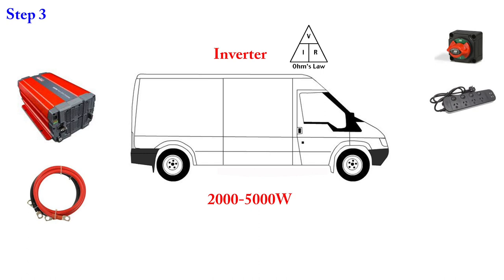You also need good cable for the inverter — something about the size of jumper lead cable, if not slightly larger. You can get this from boating shops. Then I recommend a very heavy chunky switch — something like a 200 to 250-amp mechanical switch — so that if anything goes wrong you can isolate it and also turn off the inverter when not using it. Some inverters come with remote keypads or eco modes, but I like to just use a manual $20–$30 switch with ring terminals, fully insulated.